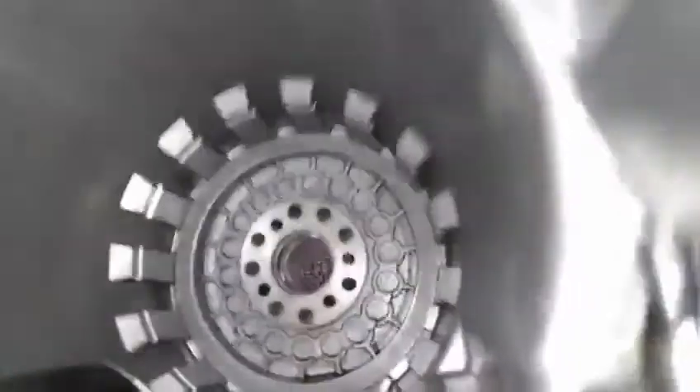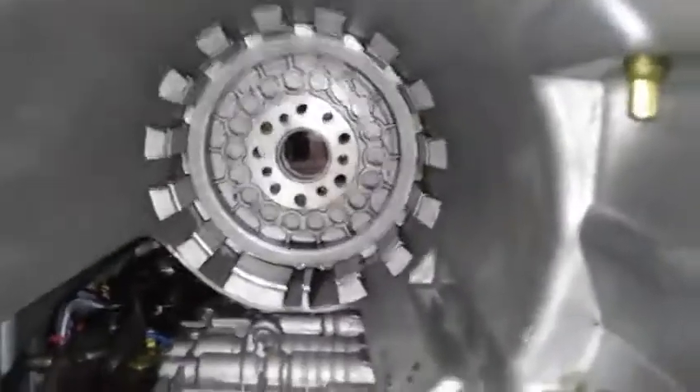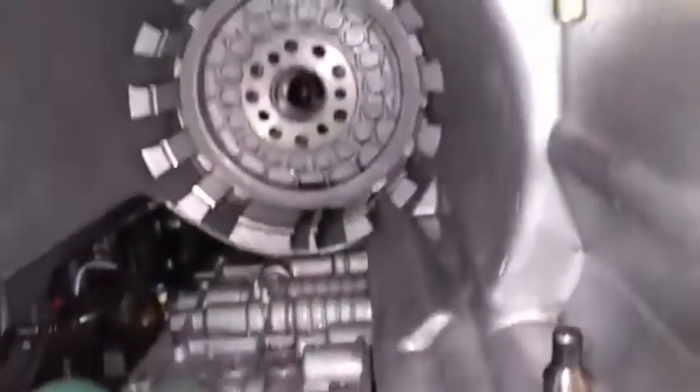When you remove these clutches, you've got to look for a C-clip in there because it has to be replaced — that's what it looks like. It has to be installed like this: this side is front and that's the rear. That curve is against the casting on the wall, and you want the 90-degree bend with a hole to be against the steel liner.